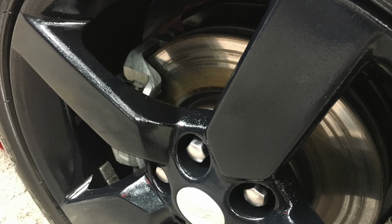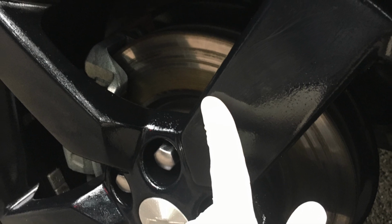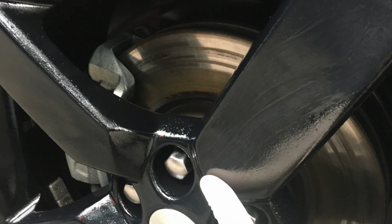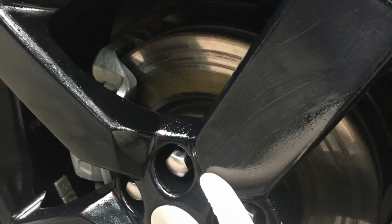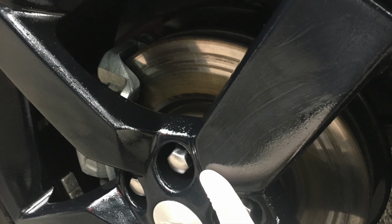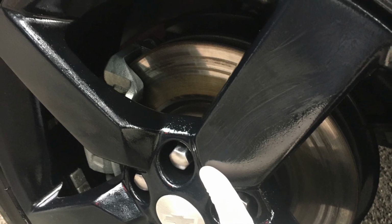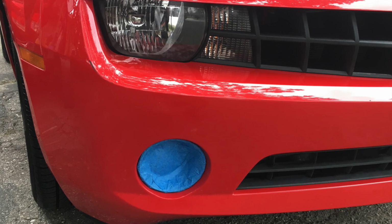All right, here we are with a few close-up pictures of the tire shine and how it looks. I just smeared my finger over it so you can see how much it was caked on, the silicone. And guys, just can't stress enough how poisonous this is, especially to the clear coat. This will just really destroy your paint job, and a lot of times you won't even notice until you get to the end, and your job could be ruined. So you want to be really careful of this and just be aware of, you're feeling it, you're seeing if anything feels too slick, or looks too shiny.